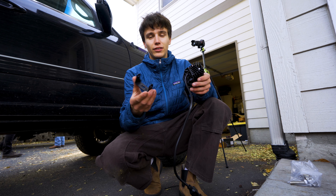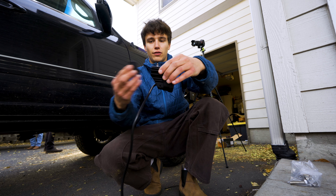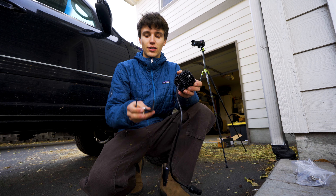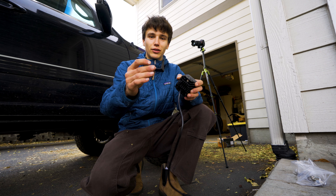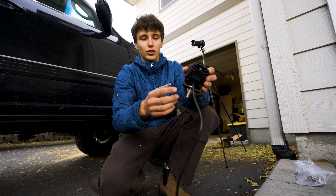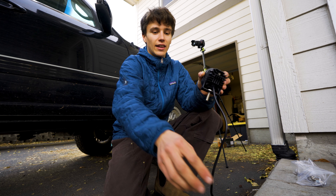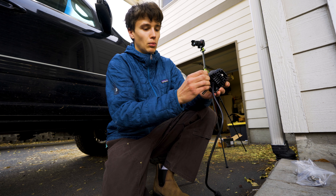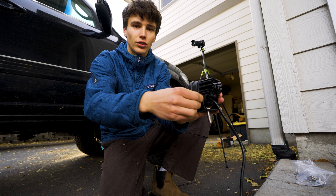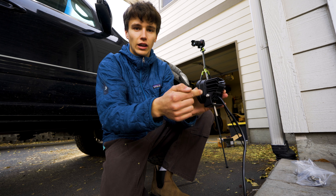Technically with the mounting bracket you can mount it either way, but the way I'm going is with the slope facing towards the front of the ditch light. Before you tighten the mounting bracket down, make sure you put the through bolt through the mounting bracket first — otherwise once you tighten it down, there's no space to get that bolt through. So put the bolt in first, then thread in the bolts we removed earlier. There are two holes on the ditch light, top and bottom — we're using the bottom bolt. You'd only use the top ones if mounting it vertically.